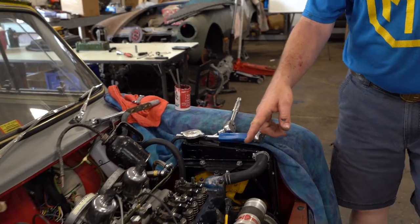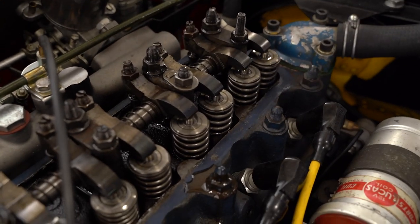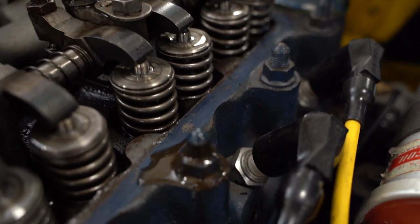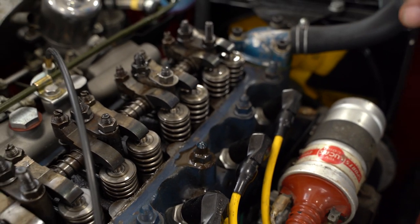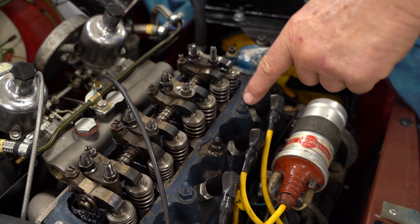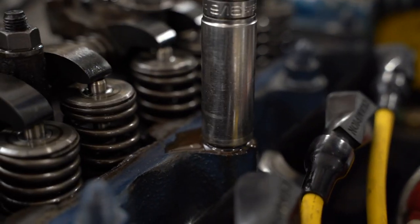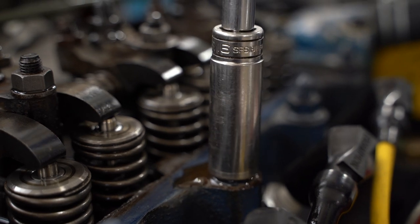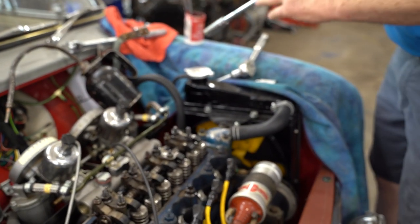And I'm just starting to torque the head. So the first bolt that I took out, the first nut that I backed off, of course, the whole stud came out of the engine. So I walked over to the vise, undid the nut from the stud, put the stud back into the engine under about, I don't know, 5 pounds, something like that, and then put the nut back on top and oiled it. Now I'm just about ready to torque it. I've got it set up here to 55 pounds, and I'm going to bring it down. That's my click torque. I'm at 55 pounds, and now I can go to the next one.